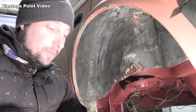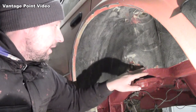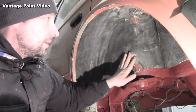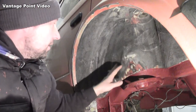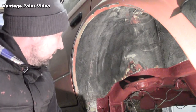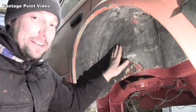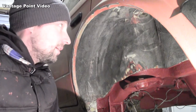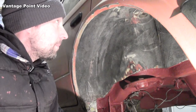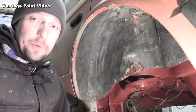With these rear arches I'm just going to use some more of the rust primer paint, but I'm only going to do it on the areas that I've exposed because there's a really good solid underseal still on this. I'm fairly satisfied that it wasn't put on as a concealing exercise because everything seems to be solid - there's no traces of filler or anything like that. So I'm happy enough to let that stay and just touch up around it.